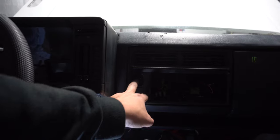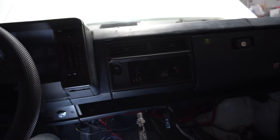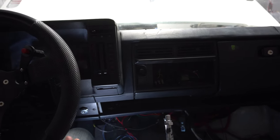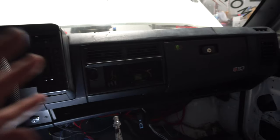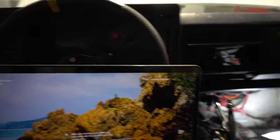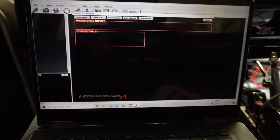It's kind of cool that I have some options and it's pretty neat to be able to play with nitrous like that. So last thing I have to do is hook up this little activation switch — I could bypass this and do the same thing, but then you could spray the bottle without that switch on. So like in static burnouts and stuff, we don't need nitrous, so you can just leave this off and do your normal burnout. But in the Aussie-style burnout skid pads, then you'd kick this on, it activates that normal stage, and the computer will take care of it from there. As my jumbled mess of wires — getting everything tidied back up — we might be there. So now we just need to try and program in the stage within the Holley and see if we can make this thing work.